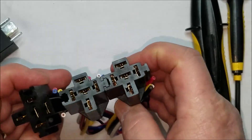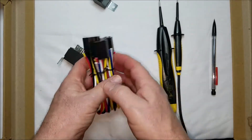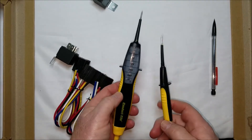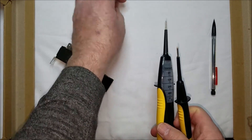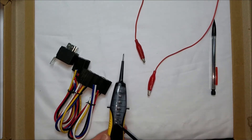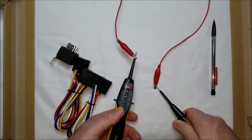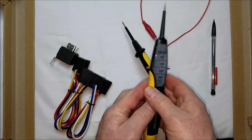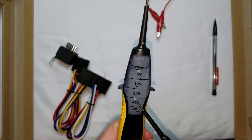When I get it all hooked up it is going to look like spaghetti. I don't have fans but I have a continuity tester — it tests for 6 volts, 12 volts, 24, 48, and continuity, also DC. For continuity, if you have a wire with alligator clips and touch one end to the other, boom — there's continuity, meaning there's no break in the line. That's going to come in handy for troubleshooting later. When we hook it up it'll light up at 6 and 12 volts.